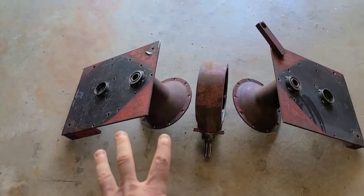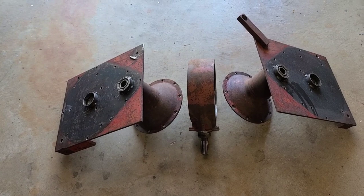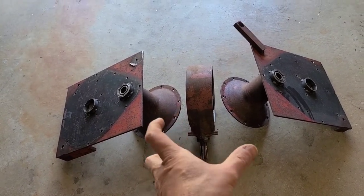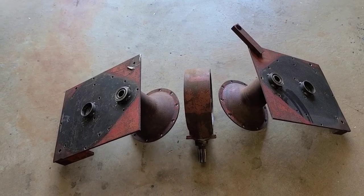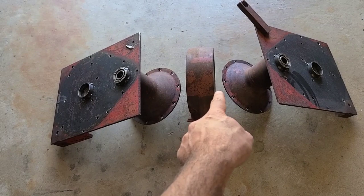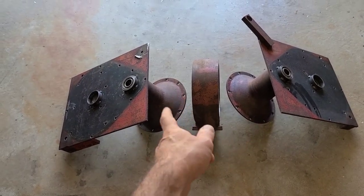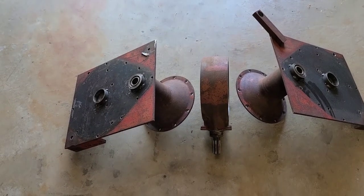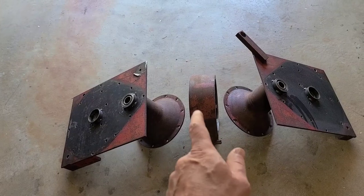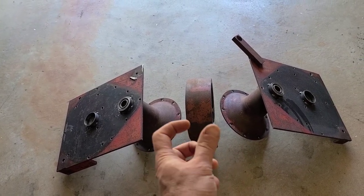So that's what we're going to do. I'm going to go ahead and bolt that on first and then drop the differential in. From what I've learned online, reading some articles, there's a series of gaskets that have to go on either side of the case. And that sets the preload on the roller bearings where the big races are. Now, there were a couple gaskets in this, but when you turn the pinion, it would go donk, donk, donk, donk, donk.